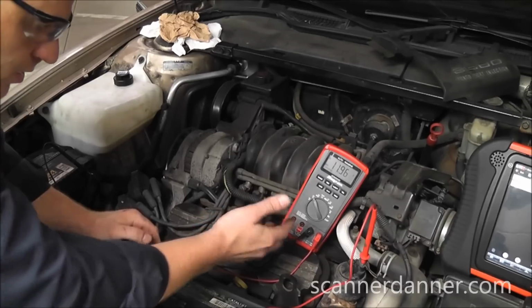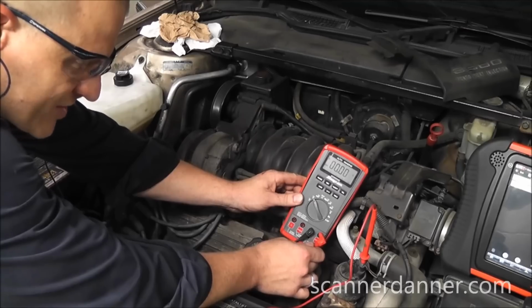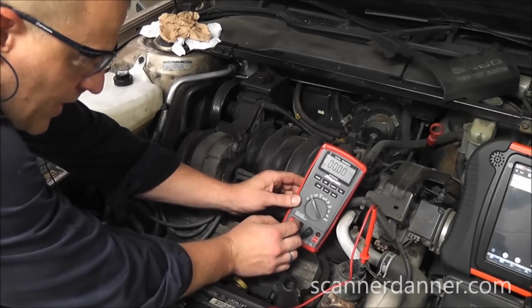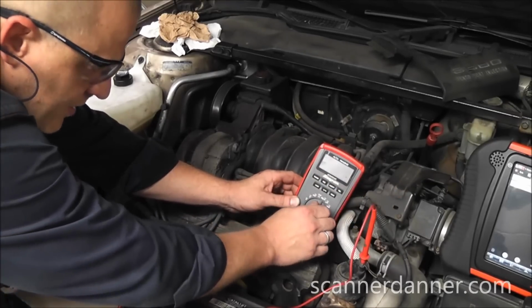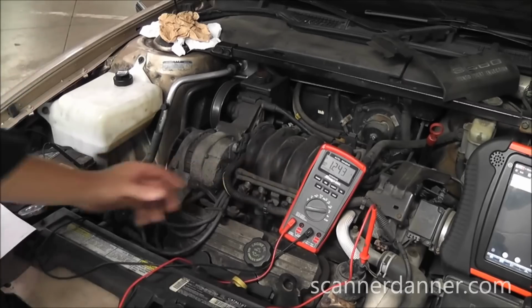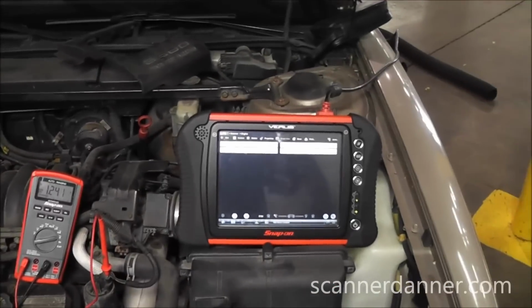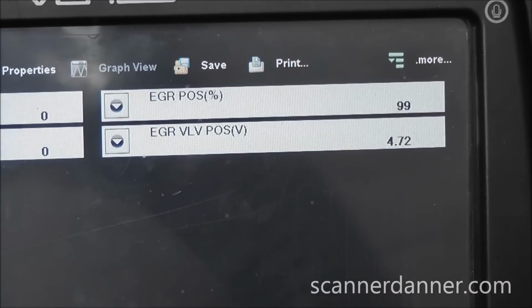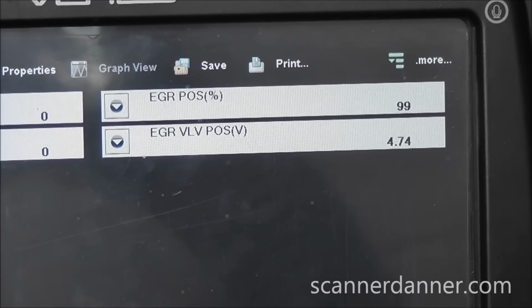And knowing your meter, just taking this lead over here, taking it away from that very, very high resistance that's in the voltmeter, moving it to the ammeter, and no reading up here. I'm still on voltage, doesn't matter. I just connected this to ground, it clicked. You want a reading of amperage, you can move it over. Reading 1.24 amps, very high current solenoid. Get you a shot back on the scan tool, and you'll see that my EVP signal is 4.7 volts. Take this off, watch the valve close, 0.8, energize it again, watch the valve open. That is a confirmed fix.